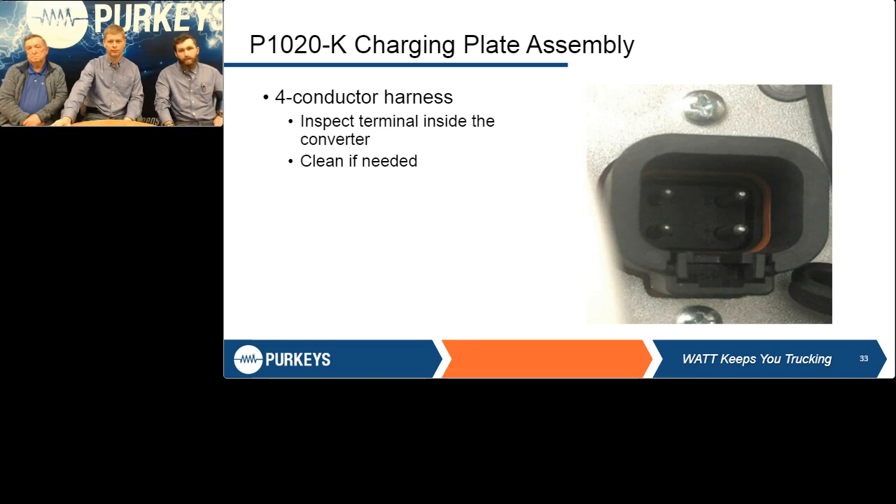When you have the harness apart, inspect the mating connector on the DC-to-DC converter. If it has been heated up, it will often have a black scaling or coating from the heat. Use something — even a small piece of emery cloth — to clean all that black oxidation off the terminal so you get a good clean connection. If you don't clean it, even after replacing the harness, you can easily have a repeat failure. From a warranty standpoint, a lot of times the first instinct is that the converter has failed. But make sure you clean that pin thoroughly — cleaning off the debris around the base and the pin itself will make a solid connection for the new harness and save you shipping costs. Nine and a half out of ten times when we receive a converter for warranty, there's nothing wrong with it.